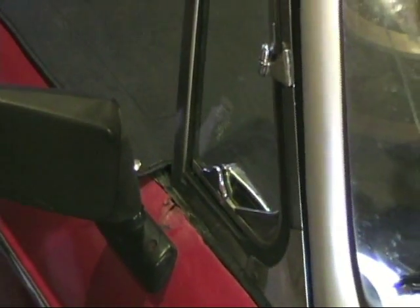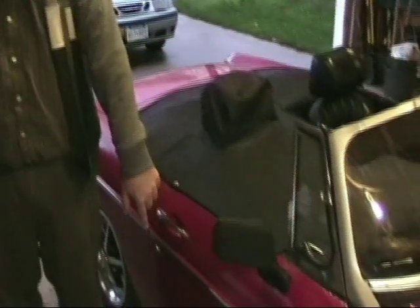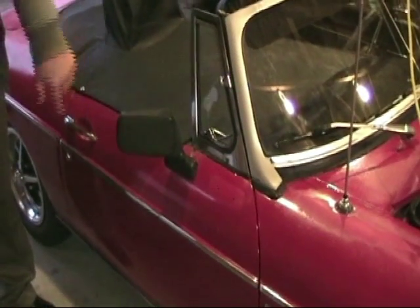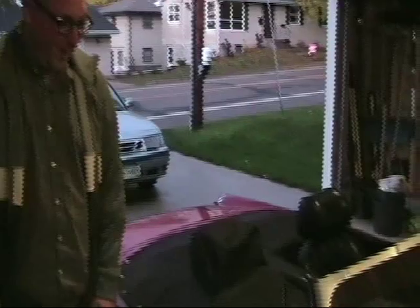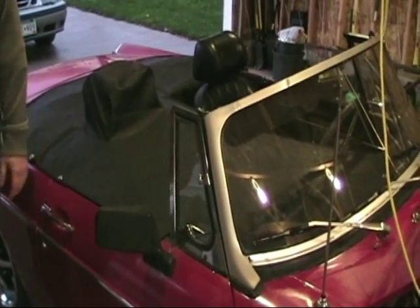Why does it have those? I don't know exactly. Being a convertible, it's a unibody car, so it tends to flex in the middle. I'm guessing when it flexes, it breaks the paint apart. And as the sills and rocker panels rust, it loses structural integrity, which causes it to flex more. That's just a guess — I haven't really looked into it deeply.